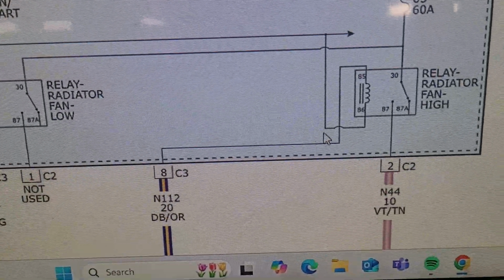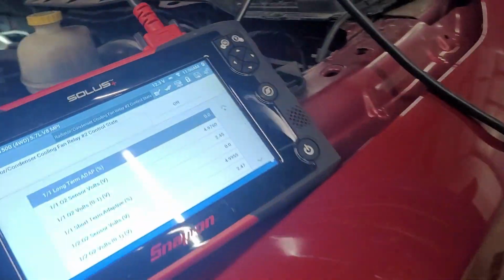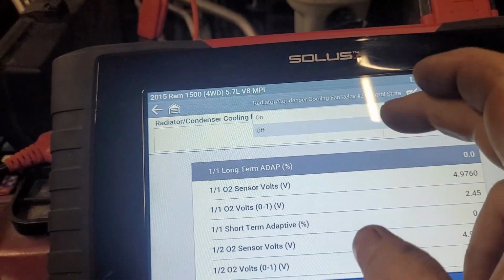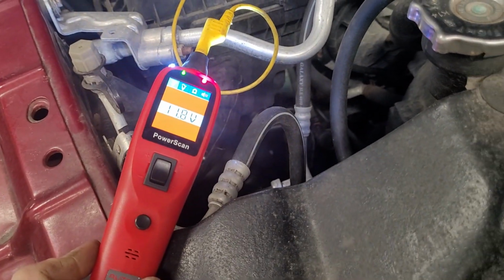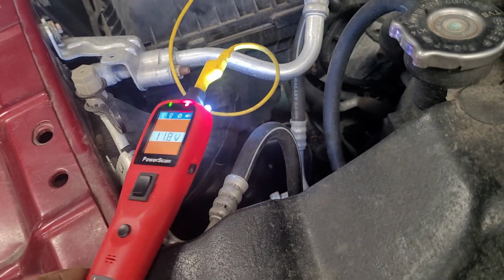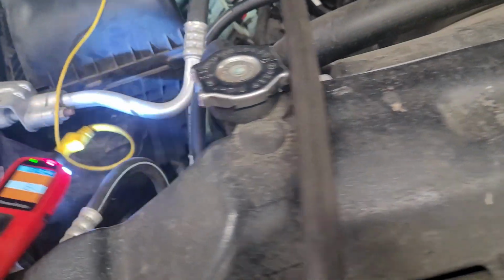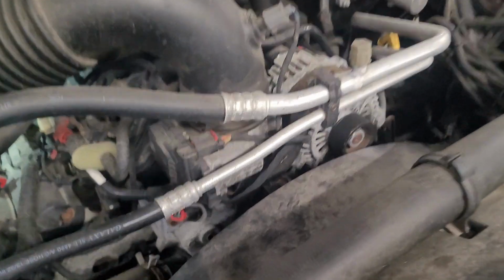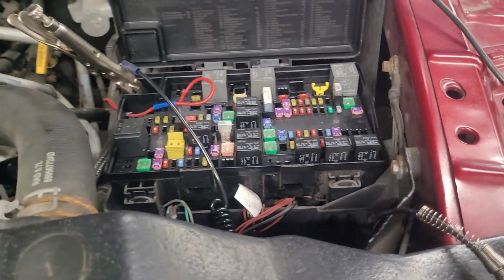And then the positive voltage is going to make its way all the way down here with it off. And I'll go in and I'll turn this to on. In a perfect world, you heard a bunch of stuff, but it's not the relay we want. This would be a ground now, but it's not. So I'll turn it off, and then I'm going to ground it here, and the fan's going to come on. So just like that, Bob's your uncle. You need a PCM.